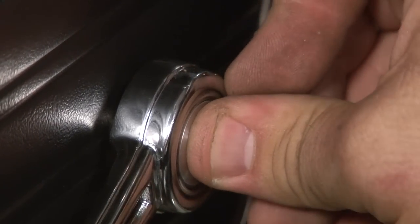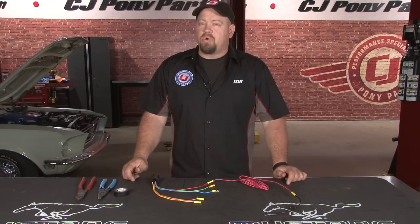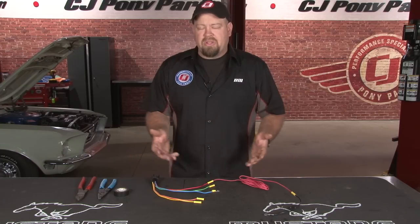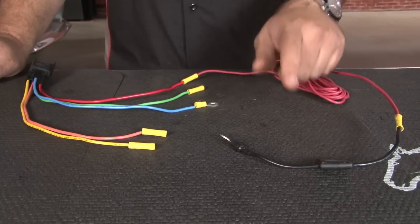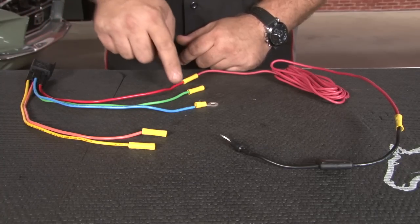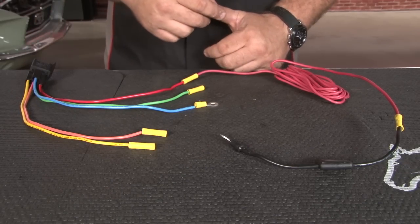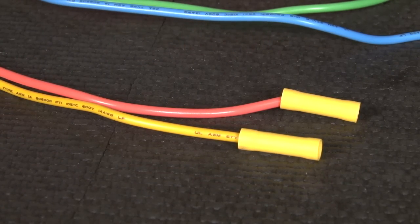Re-stick on the original disc. Now we'll move on to the wiring. The windows are going to require switched power. Unfortunately, under the dash of your Mustang there's not going to be anything strong enough to power them without blowing a fuse, so we're going to have to go with a relay. We're using a five-post standard relay available at any auto parts store. You're going to start by connecting a fuse link to the battery itself, then run a primary wire to the red lead into your relay. The green wire will get 12-volt switch power somewhere underneath the dashboard. The blue wire goes to ground. The orange and yellow are both powered and will run your windows. Connect the power leads for your windows to the yellow lead from the relay — that's the lead that has 12 volts when the relay is open. If you connect to the orange lead, it's only going to have 12 volts when the relay is closed and the ignition is off.